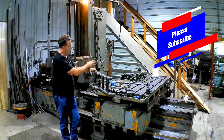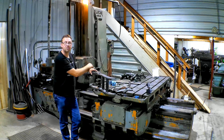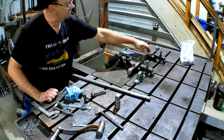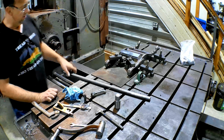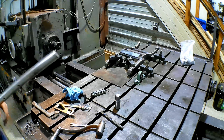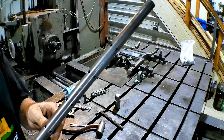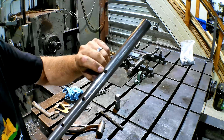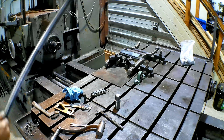We're going to go ahead and finish setting up. I've got the first one mostly in there and we'll start line boring. As you can see, I've got it set up and clamped down, with stops, and a pillow block bearing out here as my outboard support. My boring bar — I made this because it was hard to find a one-inch bar and I wasn't paying six or seven hundred bucks for one. It's 4140 pre-hard with quarter-inch square broached holes and a set screw to hold the tool in.